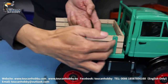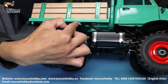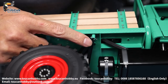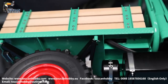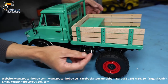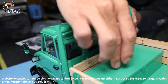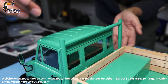This wood floor is all secured by screws. The bucket at the rear side is connected here — the chassis has a ball-shaped connection that inserts into this pipe, then secured by this screw. So this bucket is only secured by four points; after you unscrew it, the bucket can be taken out. The bar is with the bucket. The cabin and the bucket are completely separate — not connected to each other. They are only both connected to the chassis.